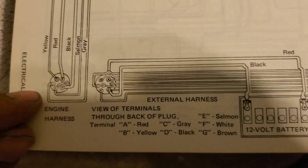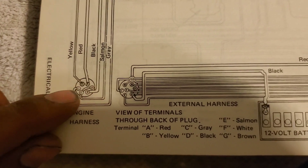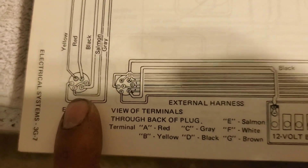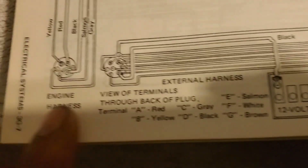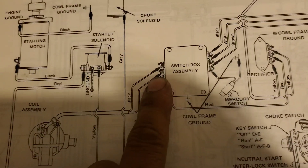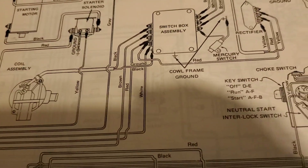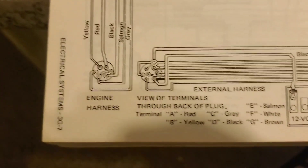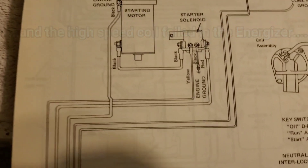So we're back to why I don't like the Energizer harness. As you can see here, E is connected to G, and you have your yellow, black, gray, salmon — all that stuff. And then all the way over here, you have brown that appears out of nowhere. This is your tach signal, and it's connected to the kill switch. There's a module you can get that's supposed to make it work, but just those two wires connected and then the brown appearing out of nowhere just seems like a poor design — probably very good back in those days, the late 60s. This is the ignition system we went to, and as you can see, there's an independent brown wire that goes up to the switch box for an independent tach reading — which actually didn't work on this model. So I'm going to hook that tach wire up to the alternating side, the yellow side of the alternator, and that should work. That was really my main qualm — ENG being connected over there — and here they are completely independent. That was the main reason for the upgrade.